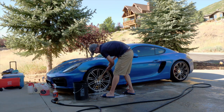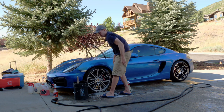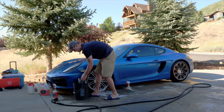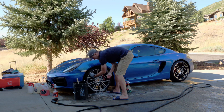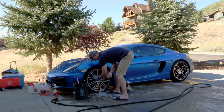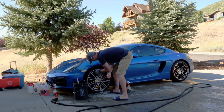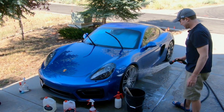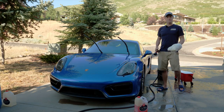This brush is great for getting in between the spokes and into the inside of the rim. A little trick to get your brush past the caliper: stick it in over the caliper first, then twist 180 degrees, and then you can scrub the inside of the rim. This is going to mostly take care of these rather difficult-to-clean wheels. I also do it by hand — I take a wash mitt and after all that, I go after each of the spokes individually, getting down in and around where the spokes connect to the rim surface. Once you rinse, onto the fun part — the surfaces.